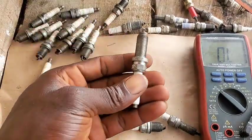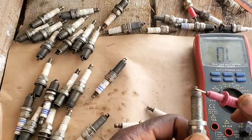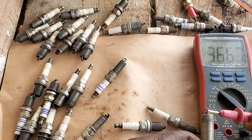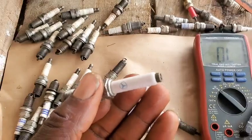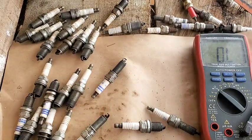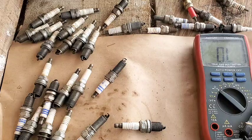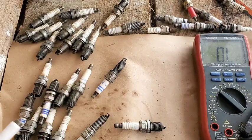The first one I want to test — 3.66k ohms. Like I told you from the visual inspection, this spark plug is in very good condition and not due for replacement; the resistance has confirmed it. When mechanics lack the right information to diagnose a problem, they make you spend money on parts that don't need replacement — they replace things because they can't separate and properly diagnose the issues.